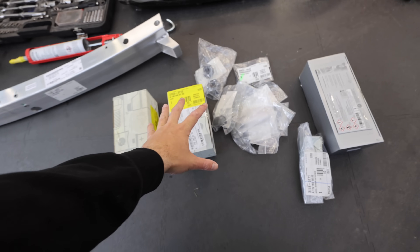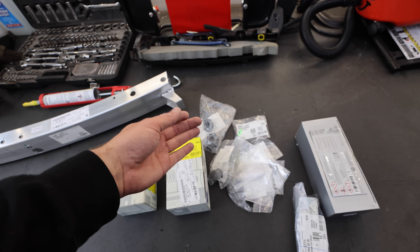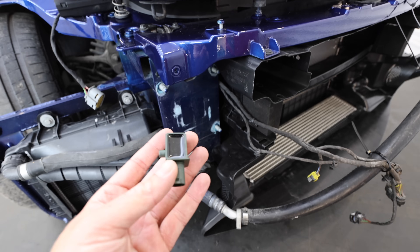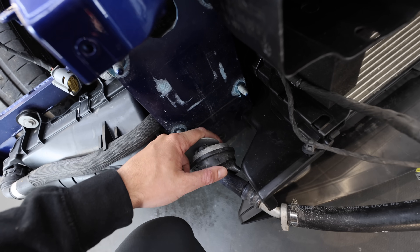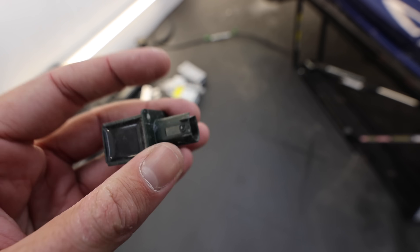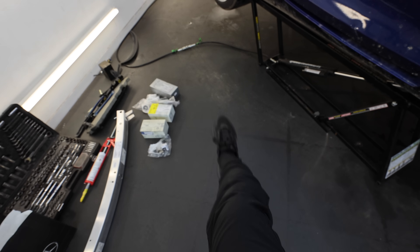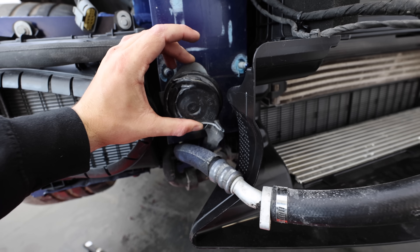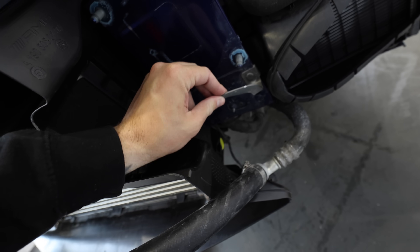You have to be vigilant when looking at buying secondhand parts. This is just a small selection of the parts I've bought brand new from Mercedes which worked out to be cheaper than buying them secondhand — if they were available at all. One of these parts is a crash sensor which bolts onto the back of the front-facing plate of the chassis leg, just behind the horn. The old one's removed and you can see it's only got a little bit of damage to the plug section, but it's better to be safe than sorry. The horns are both done too, so we're going to whip those off and pop on the new ones.